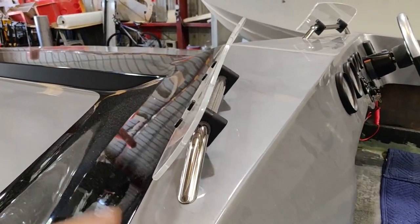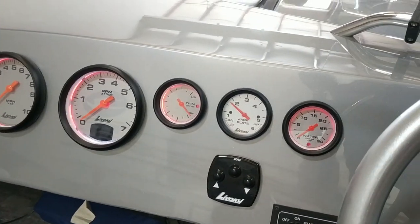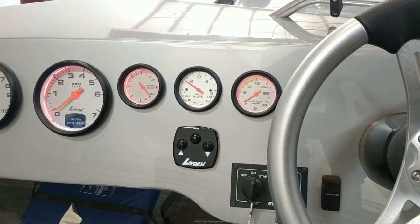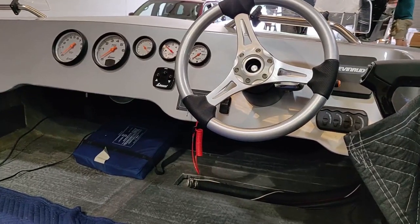Finney's wind flaps are on — pretty much everything is set up to put the gauges in and got them working. We got the Evinrude icon — it's a 4.3-inch screen, the small one — because we don't really need too much out of it, just basic diagnostic stuff. We needed that screen to switch from our foot throttle to our hand throttle, which is a feature you need at least that size screen for. It's the perfect size for a single engine setup.